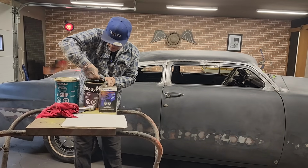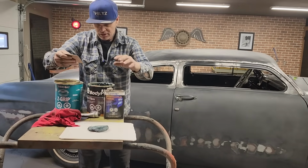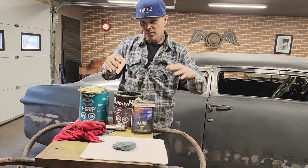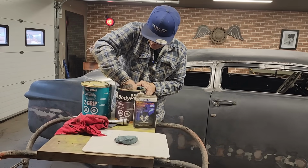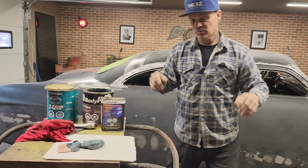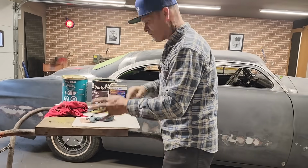We got some fiberglass here, and you can see that stuff. I say it every time. It's dense. Listen, if you have a spot that you've warped up or you've played with and it's just sort of a mess, it's just something that it's hard to deal with, this fiberglass is really good to put in that mess, and the reason is because it's dense, it's hard, it'll take that boinginess away if you can get it in the low spot that you're going for.